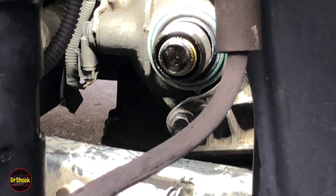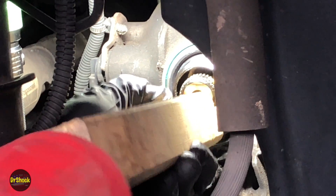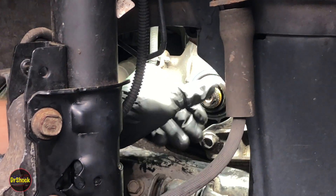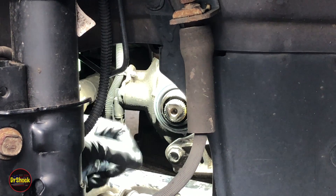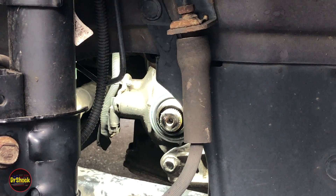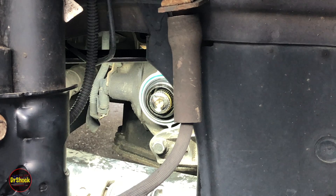Now we just need to tap it in gently. I felt it slip onto the detent, so I think we're good to go there — it's sitting about where we would expect it to be when we put the axle shaft on. If there's a little bit of a gap that we've missed, it'll close up when we do that. That's it — that is the rebuilding and reinstalling of a stub shaft with new split rings, a new sleeve seal, and a new cover seal. If you have questions or comments leave them below, and if this saved you some money, hit that like button — thanks for watching.